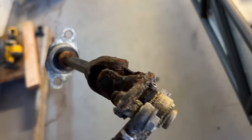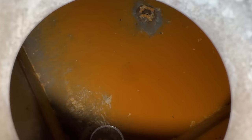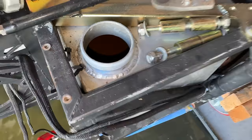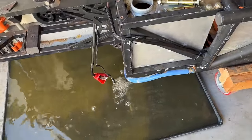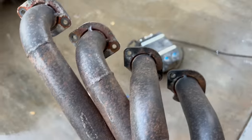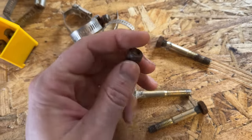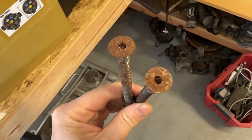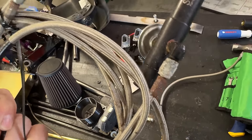The U-joint for the steering was also trashed — I did kind of half-ass the spray painting on it, so that's not too surprising. The coolant system is filled with mineral deposits because I filled it with hose water to get it running and never bothered to swap it out for distilled water, so now I have to figure out how to flush the system. The exhaust was ceramic-coated, but it didn't hold up that well to the salt. Most of the fasteners had some corrosion — the yellow zinc-coated ones fared well, except the nuts did a lot worse than the bolts. Hose clamps did poorly, black oxide all got destroyed, and my brake lines will need to be replaced. Most of the braided steel lines did okay, but the fittings at the end got trashed.